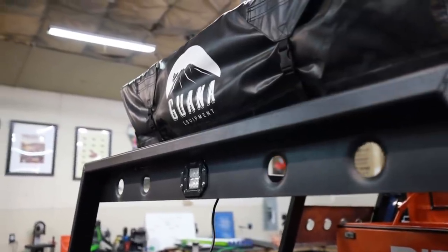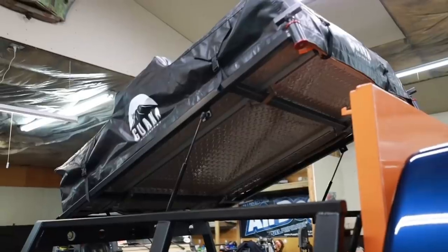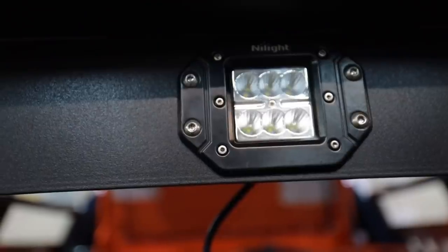I completed a little bit of work since the last video but you guys didn't miss much. I added a rear panel so I could mount a third reverse light and I welded on a couple tabs in order to mount these gas struts. These universal struts are rated at 150 pounds a piece and can be found on Amazon. The paint is just spray-on Rust-Oleum bed liner that I got from Home Depot. It's relatively inexpensive and it covers somewhat decent. It's not very durable so long term I plan on either powder coating this or using a real bed liner.